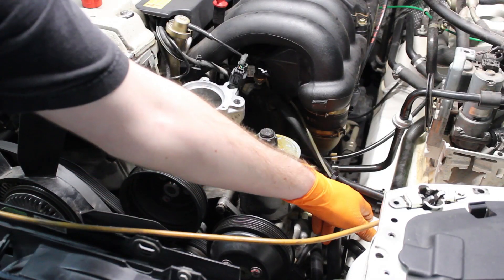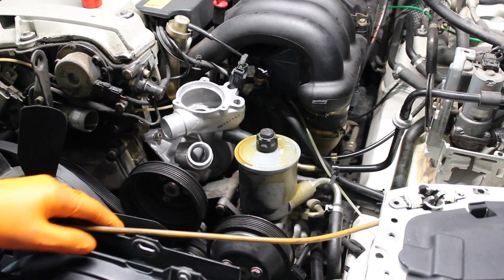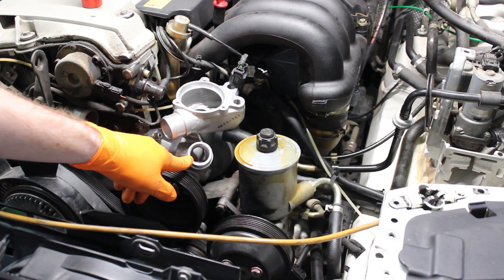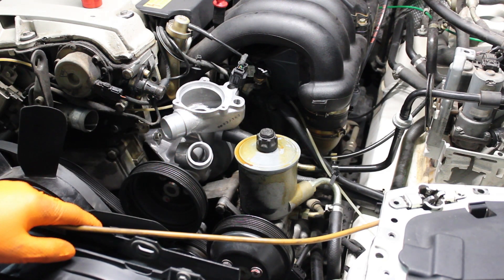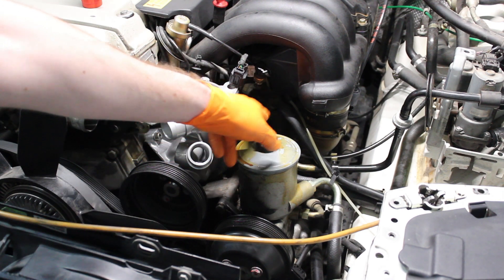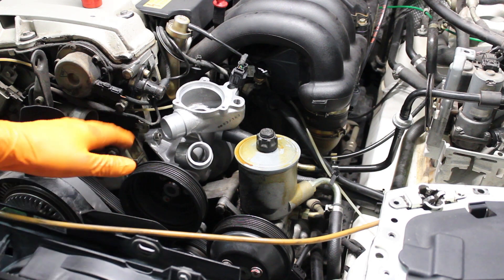I have the windshield heater hose replaced — the one that goes from the side of the water pump to the valve assembly over here. I've now filled up the water pump with water up to basically the end of the lower radiator hose water neck. I'm going to let it sit overnight, which will tell me whether any water is leaking from the o-ring face seal or the freeze plug in the back. We'll come back and if everything's good to go, we'll continue on with the video.